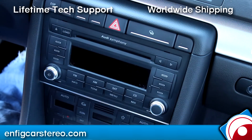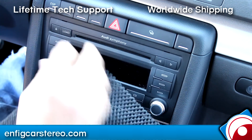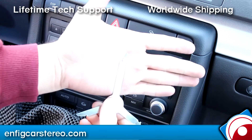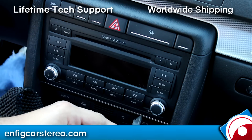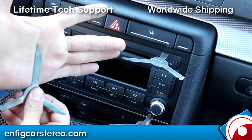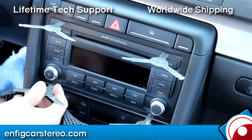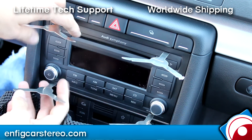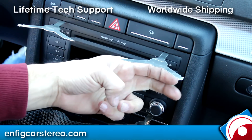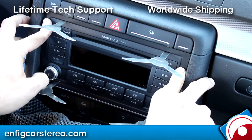First thing you're going to do is take out the radio. Always cover your shifter — you don't want to scratch it up, so just put a towel down, a sweater, whatever you got. This is actually a drawer liner. You're going to take your radio keys with the notch facing inward — notch facing to the left on the right side, and on the left side, notch faces to the right. Then you're going to apply a little — see the spring action? Just a little tug here and then a little tug on the other side. You don't want to tug too much on either side, because the things that hold it in get locked against the wall and you won't be able to get it out. If that happens, push everything back in and start all over.